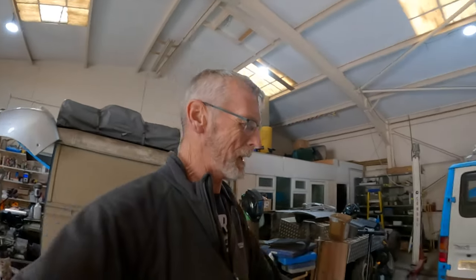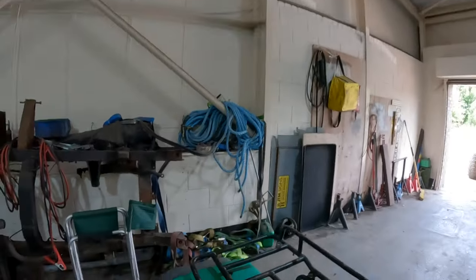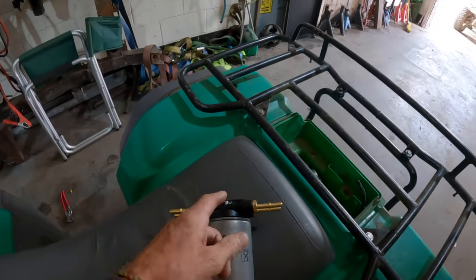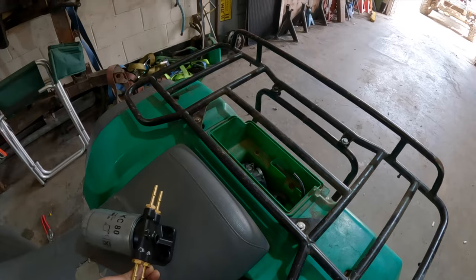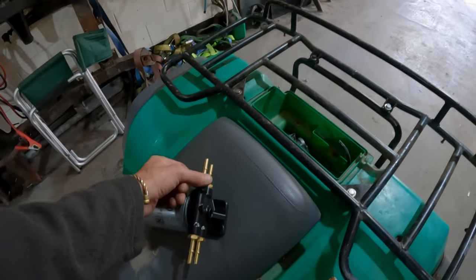Now, as a lot of people know, these D2s tend to have a lot of issues with fueling systems. I've got a thing at the minute where if it runs less than half a tank, it's a pain to start in the morning, and that's basically to do with this thing here, the fuel filter head. Inside here there's all sorts of gubbins. Inside there there's a non-return valve. Inside this one I think there's an air bleed.